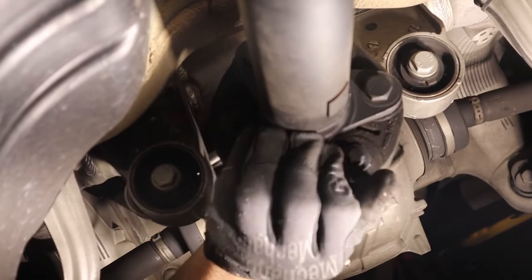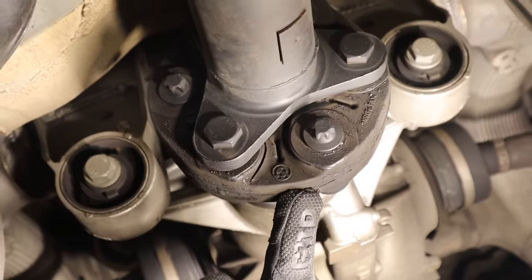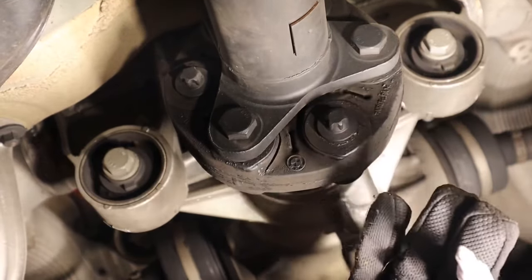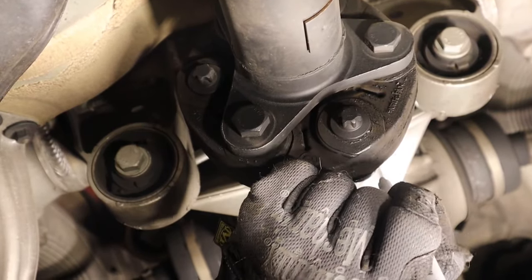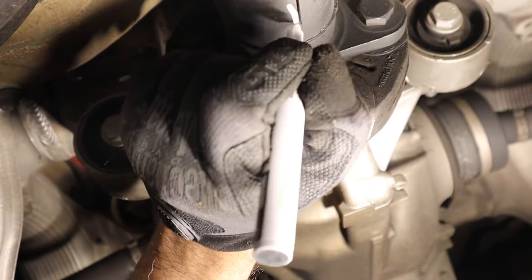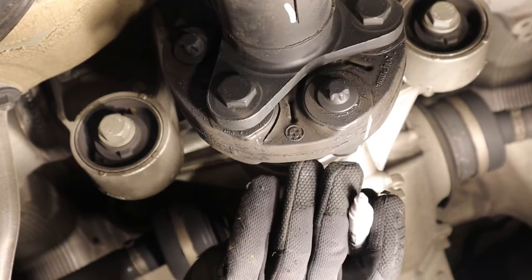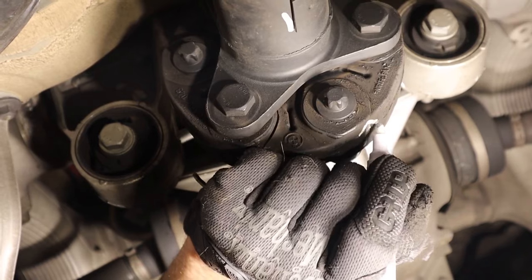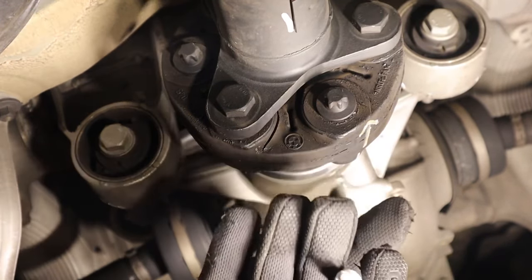Here's our culprit — you can clearly see mine has been through so much stress and dry rot it's literally ready to crack in pieces, so we need to switch this out. Before removing the flex disc, you need to mark everything so you put it back aligned and centered. Mark the three-hole flange, the flex disc, and the drive shaft. On the flex disc, make an arrow pointing to the front of the car so when you take it out you know to put the new one back in correctly.